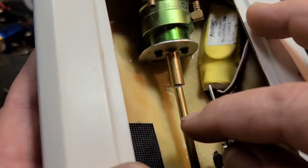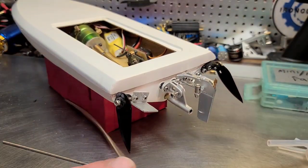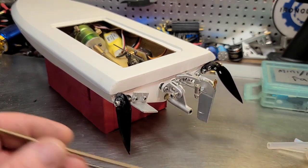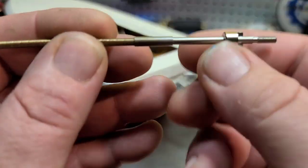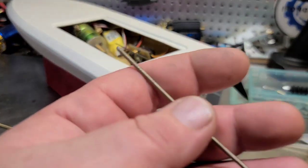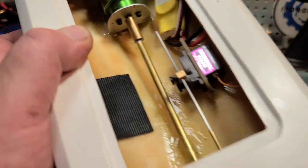We need to get our flex cable cut to size so we can put the flex cable in the stuffing tube and the collet, hold everything in place while we install our retainer so everything lines up nicely. Now with this 0.130 cable it won't fit in the micro strut — it's too big. We need to get a length basically to the drive dog, which is going to be right here on that flat spot.